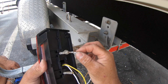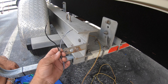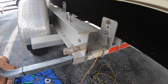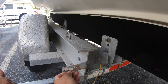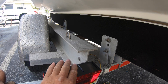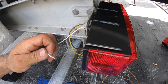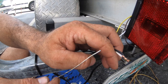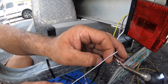There are two ways of putting this ground wire on. I'm going to install it on the outside because I have to splice an additional ground off the side trailer marker. I'm going to install it this way, and before I do that I'm going to throw it through the license plate bracket — lucky this bracket has a hole in it — so we'll shoot the wires through the hole and put the studs in here. Do not forget to use the washers and the nuts. We're going to cut that wire and splice it into the side marker lamp because that also needs the ground. On the joining grounds between our side marker and our tail lamp, we're going to tin the wire just to give it that extra added protection.